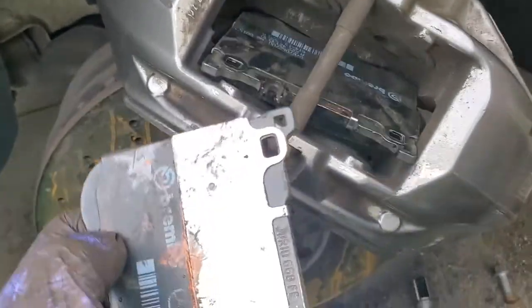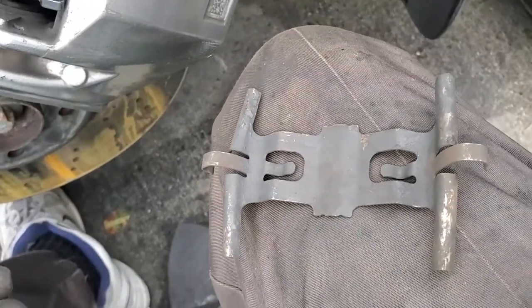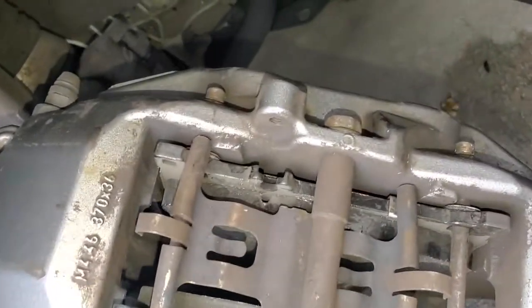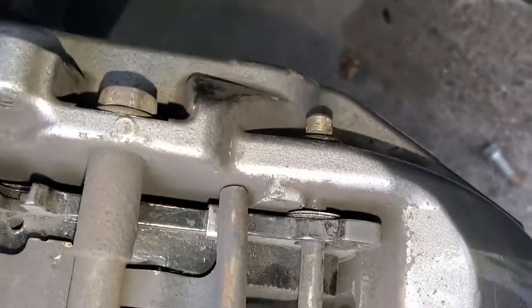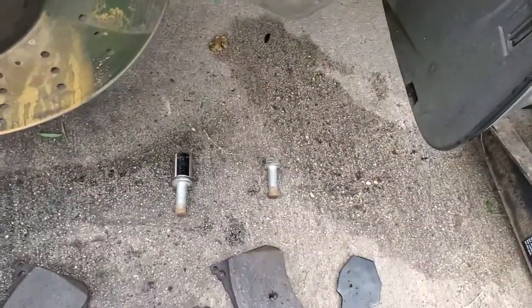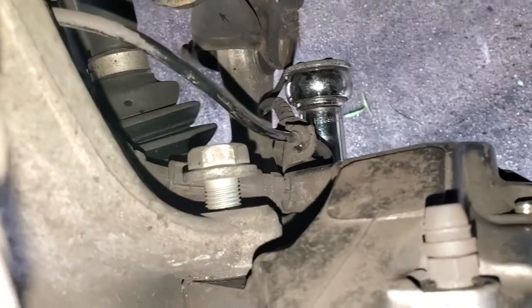After we do that, I'm going to put the top metal piece back on so you can actually see what it looks like assembled. Now that you see it's assembled, the only thing we have to do is tap that piece and tap that piece with the hammer so it actually sticks out of the hole. Then we can put the caliper back on the rotor and put back those two bolts that are attached so we can secure it. After you've got those two bolts on, everything is assembled. You've got the two pins in — use the hammer to hit those pins inside.